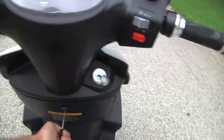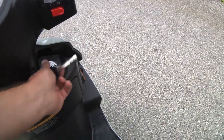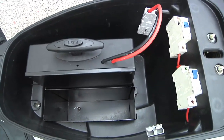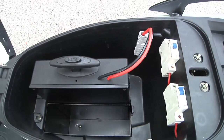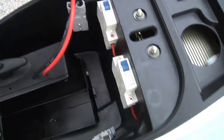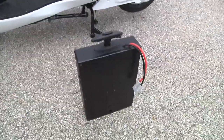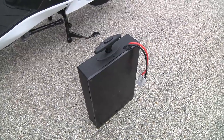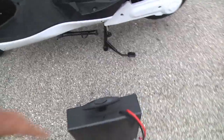On the front it does have a small storage compartment — a glove box — and the battery is under the seat. To get at that, you just turn the key the other way, pop the seat, and down here — this is pretty cool. This scooter comes with a single battery pack, but as an option you can add a secondary battery pack. It's removable and uses standard connectors. Let's say you live in an apartment or a dorm and don't have a garage — just flip that breaker off, pull up on the battery connection, and pull it out. That battery weighs a little over 20 pounds — hefty but not heavy. Easy enough for one person to lift and carry, and you can take it inside to recharge in your living room, kitchen, or at work. That one battery is still powerful enough to get you 20 or 25 miles, and if you have two batteries, you double that.